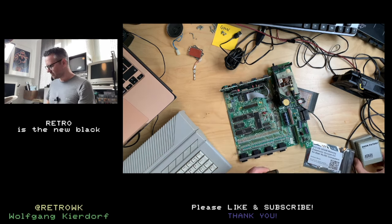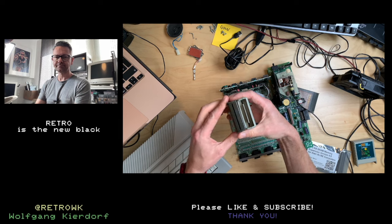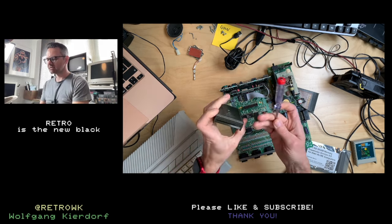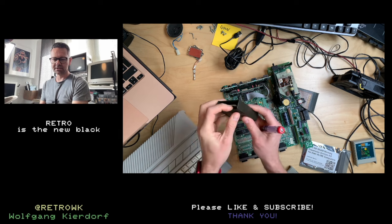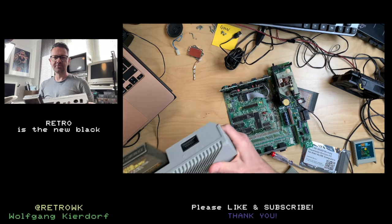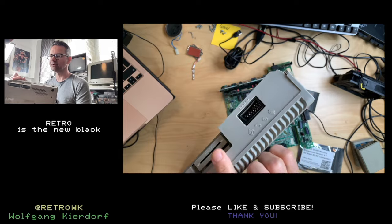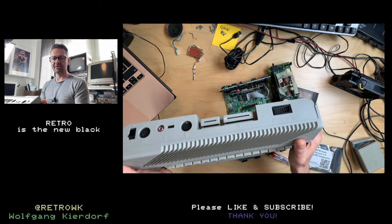I have Moon Patrol here which came with the machine, and I have a Star Raiders cartridge. You can see that you can't see the exposed connector here, so you have to have these tabs to open it. But what you can do is use a flathead screwdriver and just push here — there's just one of these on one side. You hold it and push the cartridge in as fast as you can, and voila, it snaps in. You could also 3D print something — there's a 3D model for an angled connector so you'd have your cartridge port sticking up, which is way nicer, but I haven't done this yet.